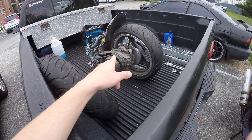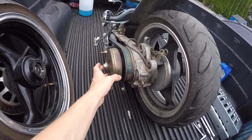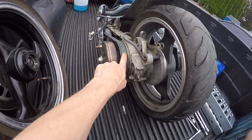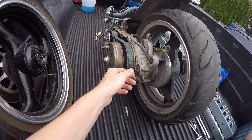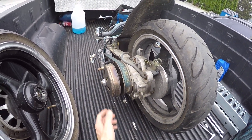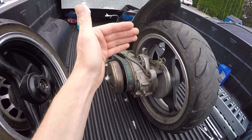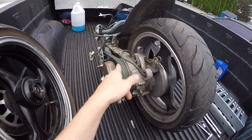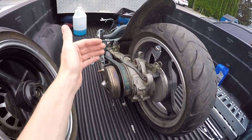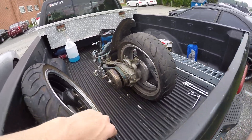Just let me know and I'll start tearing this thing down and rebuilding this motor. I definitely want to go with the NCY variator setup and clutch, along with different power link belts — probably a Kevlar belt. I'm not going to go with the four-valve head; I'll stick with the two-valve head, but I'll probably go with the 170 kit on this one. Since this one's open, I can show you guys things like valve guides, top dead center, and all that involved in building these.